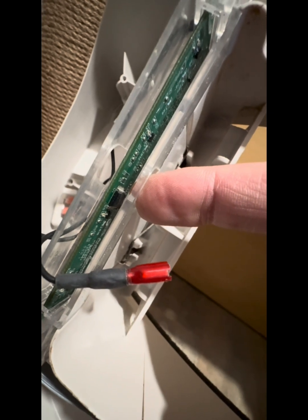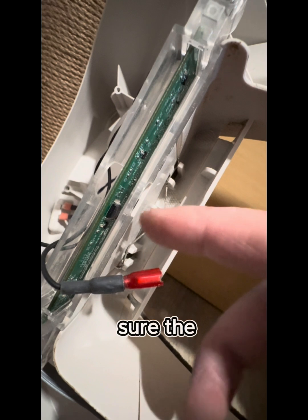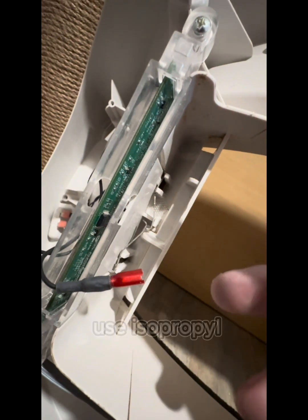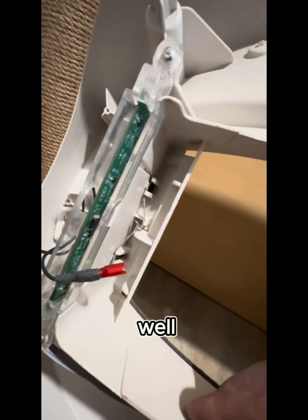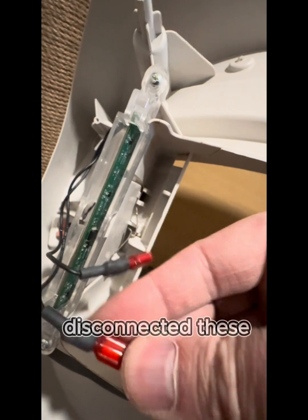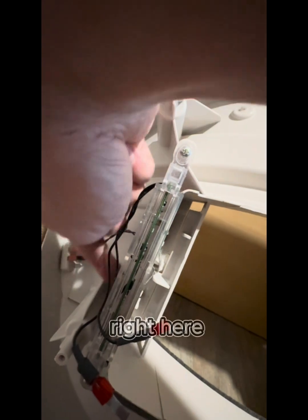It didn't look like corrosion, but it was dirty. I used a little corner of a razor blade to scrape those off and make sure that continuity was there. Cleaned everything again with hydrogen peroxide — you can use isopropyl alcohol, whatever you have. Make sure that it dries really well. Then connect everything back together, making sure that if you disconnected the pinch detection pins those are reconnected on the back side.